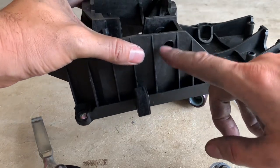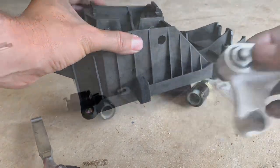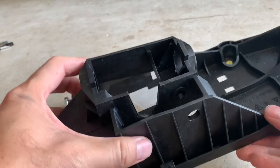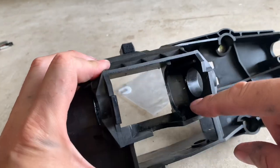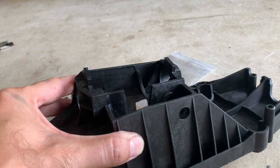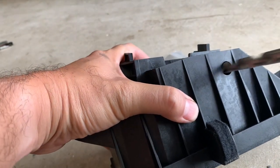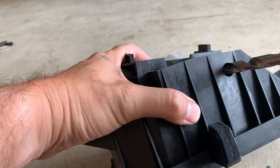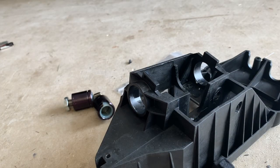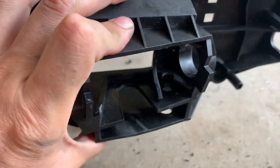We need to properly round out this hole - as I said it's got flat sides on it, so we need to open it up so we can get the bolt through it. Nothing major to modify. We need to make that inside hole a little bigger - we'll drill through that tab and flatten the sides off with a file or drill bit. We have a 10mm bit and we're just going to put it through. It doesn't matter if it's messy because it's going to be bolted on so it'll hold it all snug. There we go, we now have it notched out.